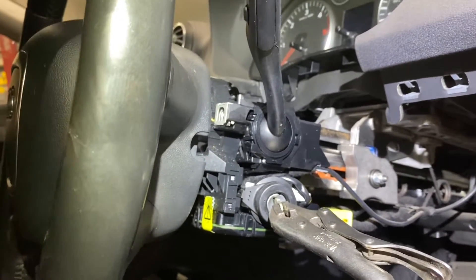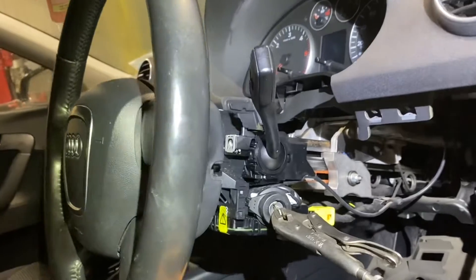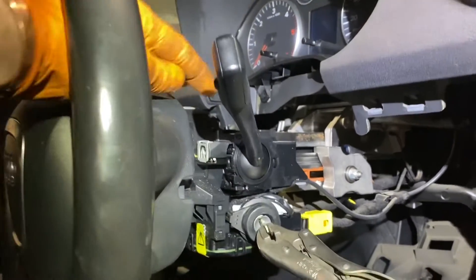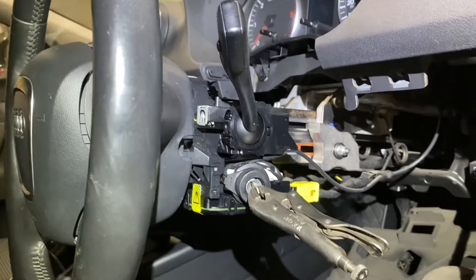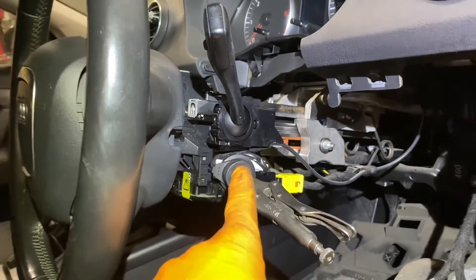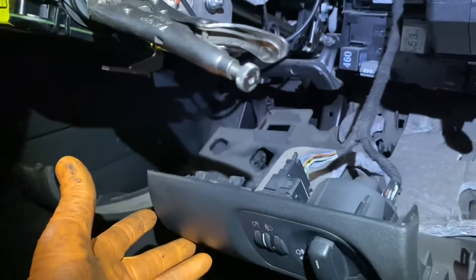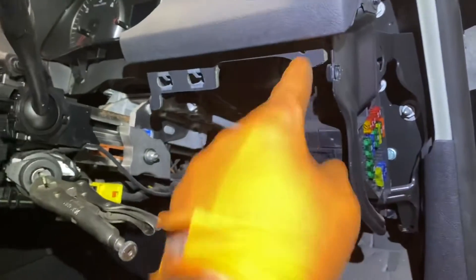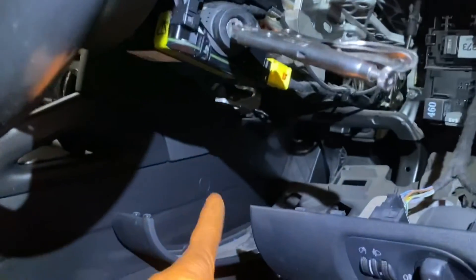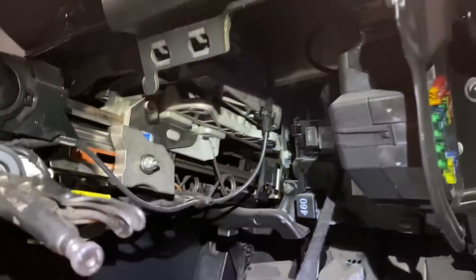What I'm going to show is how to get this out, step by step, and see what we're up against. What I've already done is disconnected the airbag. I also took the shear bolts out of the top of the actual ignition switch itself. What I'm hoping to show you is the disassembly and reassembly of this piece in order to get at the ignition switch. I pulled down this bit of plastic — it's only popped off — and there's three bolts: one on the bottom, one on top, and one on the bottom over here. Then there were four T13 bolts holding in the steering column itself.